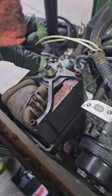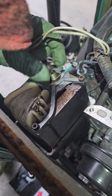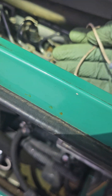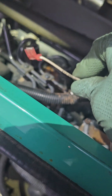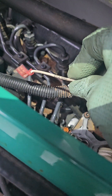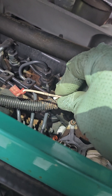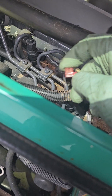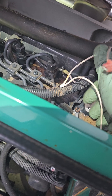The spring is in place and the actuation of the rod works perfectly, so there's nothing wrong with the actuator itself. Next, they want you to check the ground wire — this red wire here is actually the ground, the E1-2 ground. They want you to check the signal between this wire and the body of the motor to confirm you've got a healthy ground. That passed.